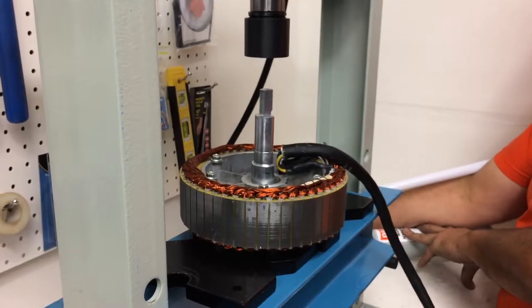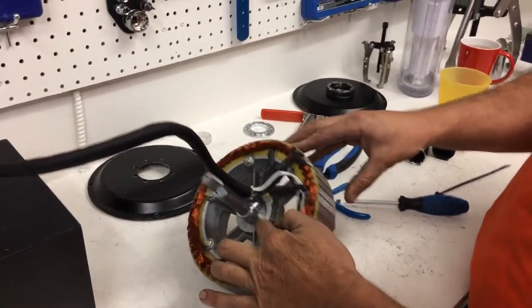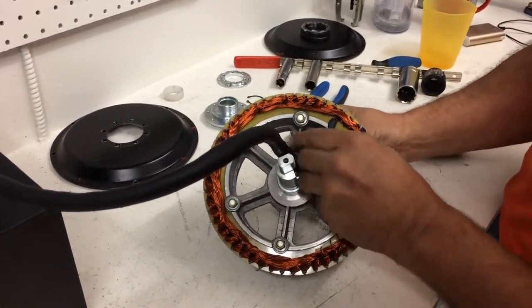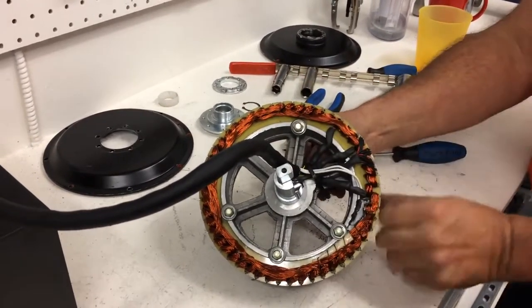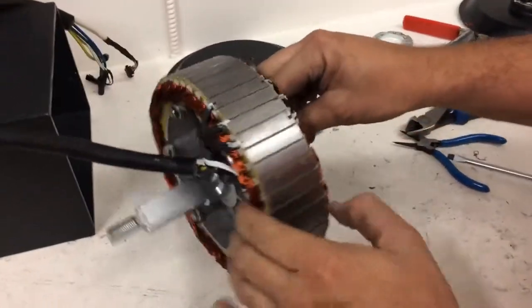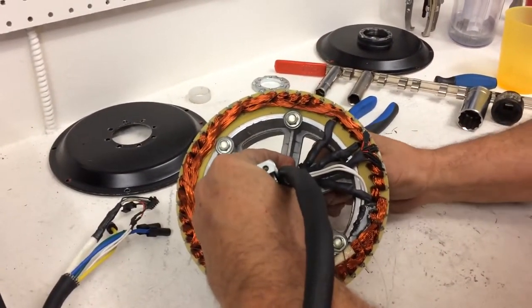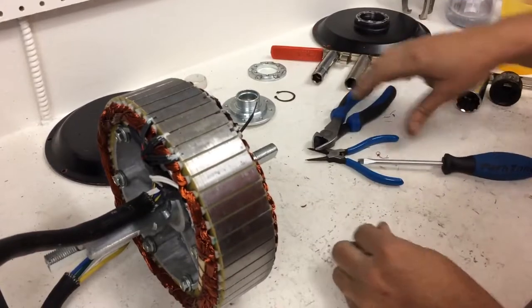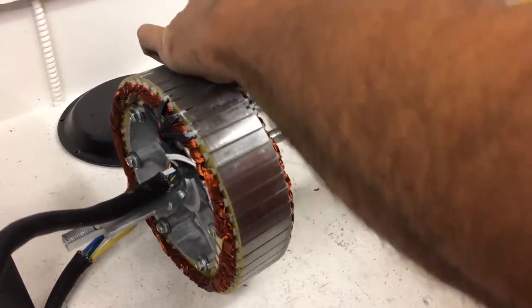So two things you want to remember when you put it back together is that you've pressed in the axle all the way, and we're going to get the zip tie on there that keeps the harness in place, and of course the snap ring. So I guess that's three things. So here I'm putting on the cable tie. Sometimes I call it a zip tie, sometimes I call it a cable tie. And not tugging on the wires, get that centered into position. Then pull this. Not too tight. Cut it nice and flush.